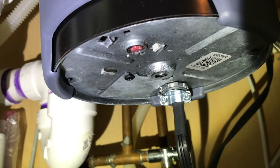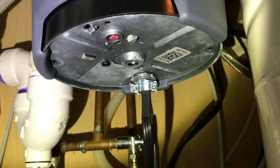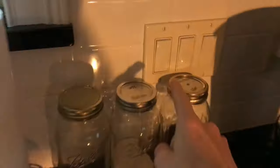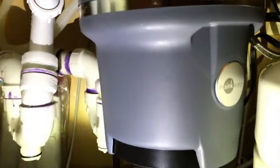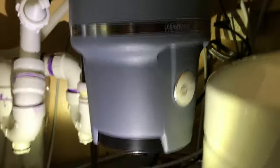Push the red breaker back up inside - it's spring-loaded and will make a clicking sound once it secures itself in the bottom portion of the disposal. Come back and plug the disposal back in, verify nothing popped out, then come up above, turn the water on and the garbage disposal switch. Hopefully that is your main cause of your garbage disposal not working.